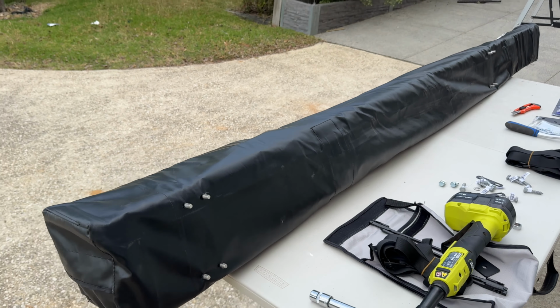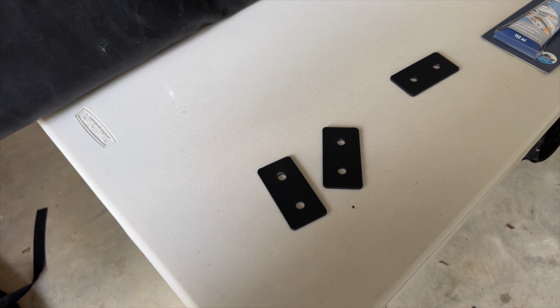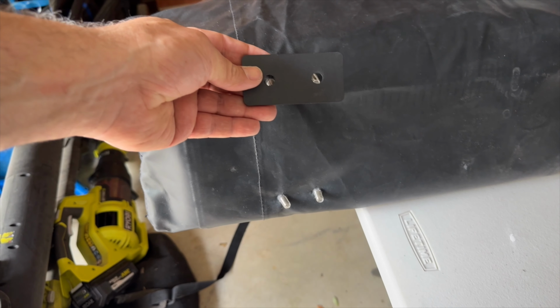So now what we're gonna do is, the way I've designed mine, because I've cut the top of the brackets like I explained earlier, is we're gonna put the lock nuts on the top two on both ends, okay? And then we'll be able to lift the entire thing up in place. Now we won't tighten it off yet because we've still gotta put a bit of silicone just to seal this properly. And then we're going to put another washer, and with the actual brackets come these for mounting to your roof racks. Now I didn't need them in my instance, so I'm going to pop these on the top as well for another bit of reinforcement, so you actually get four of these. I won't need it on the bottom, but I definitely will need it at the top just because I've cut the tops of the brackets.